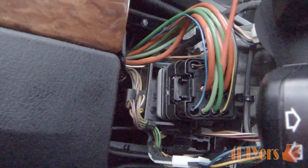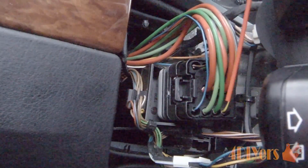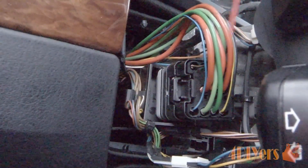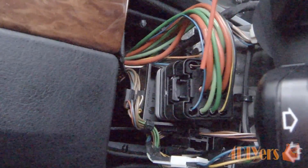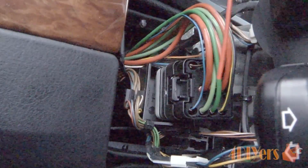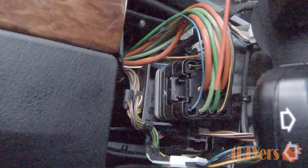There is one wire here that has the yellow and black coating on it, which activates the starter on this vehicle. I don't have a wiring diagram to determine what the rest of these wires are, but as you can see, we have three different rows of wiring — one on each outside and one in the center. The center row is fed with all red wires, which are the main power supply. Once the switch is activated, it then feeds out to the opposite sides as well, and you'll have various contacts inside the switch.